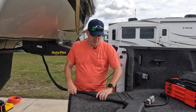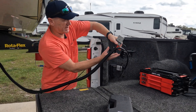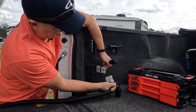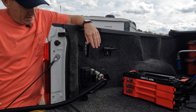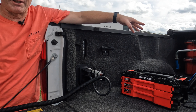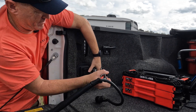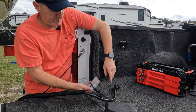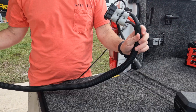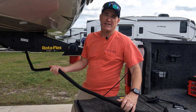This is how we have the plug set up for the trailer. You'll see the original seven-way plug, and then our Anderson plug. Basically this comes out and you have your positive and negative — it can really only go one way — and then it plugs in. When we unplug it, we just put our rubber caps back on to keep the moisture out. You'll notice we put a sleeve over our cables just to clean it up and keep the three cables from flopping around together.